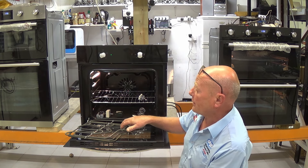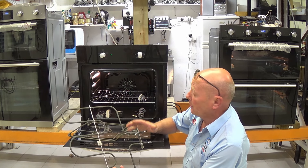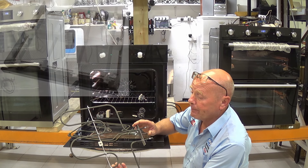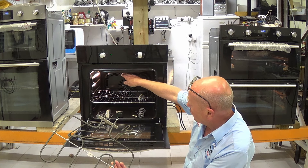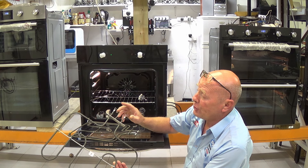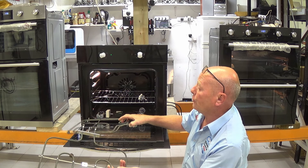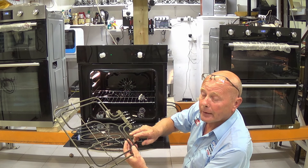First, let's discuss the elements. There are basically three types: single, dual, and as you can see in the picture, an infrared type system which is a little bit faster. The elements are normally constructed with a mounting plate that holds it to the top of the cooker. You normally have two terminals on a single element. On dual grill elements, the earth may be fixed to the chassis.